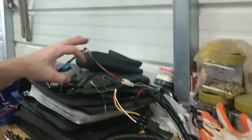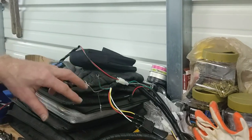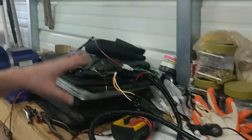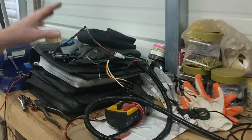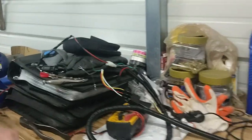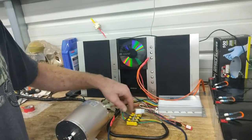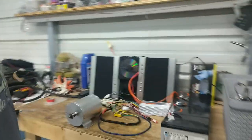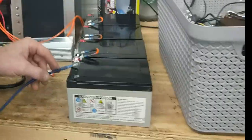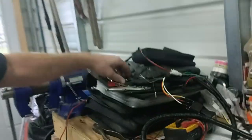For starters, we're going to try to keep them so none of them touch each other. If we touch the black to either the gray or the brown, it should slow it down, and black to green should speed it up. With none of that connected, it should be in medium speed mode. I'm going to clamp a couple wires together with some vice grips. Engine wires hooked up, motor wires hooked up. So all we need to do now is hook our spade connectors — positive and negative — to the battery here, and we should be able to arm it with the key.